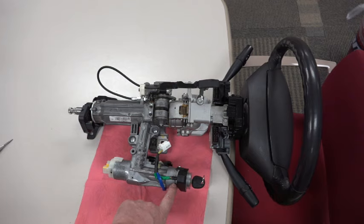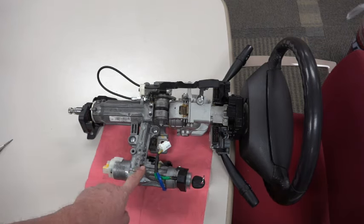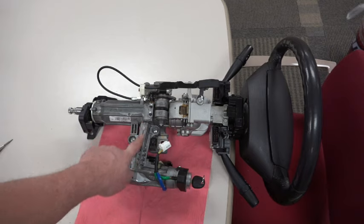What I want to do is remove the ignition key lock assembly — the lock cylinder right here. In order to do that you've got to press a tab, but the key needs to be in the accessory position to do that, and I couldn't do that. So rather than attempting something brutal and possibly damaging the lock or the steering column, I wanted to take this housing off. This housing holds the ignition lock cylinder, the ignition switch, and the column lock assembly.